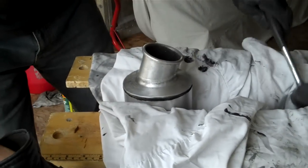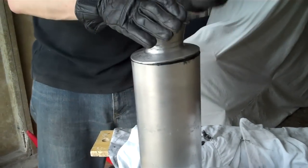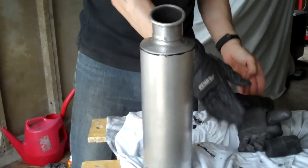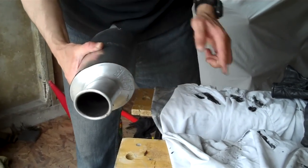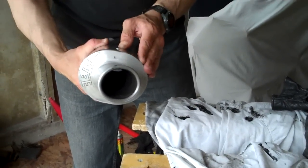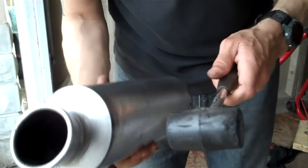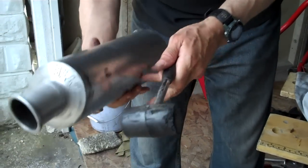This sets like hard rubber so it'll just rub off with fingers when dry, but for now it gives an absolutely airtight seal - because a gas leak is an obvious MOT fail, I can't have that. Using a rubber mallet, it's quite easy - just beat it on that corner. It's gone in lovely, absolutely lovely.